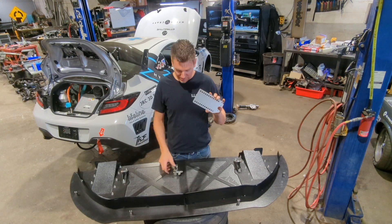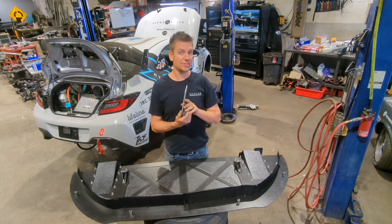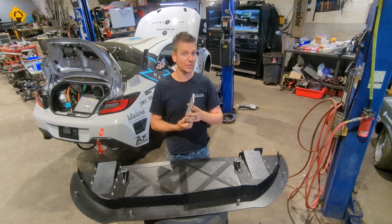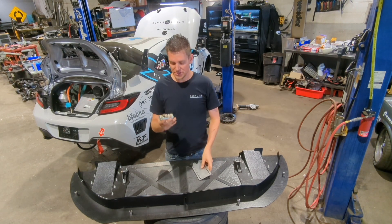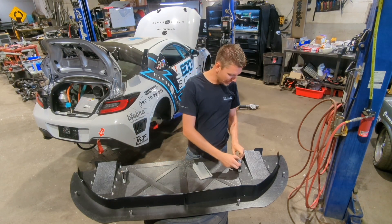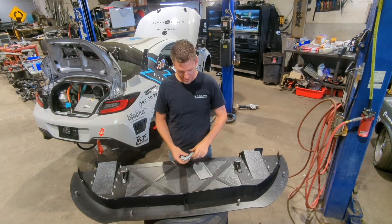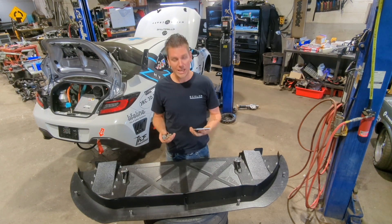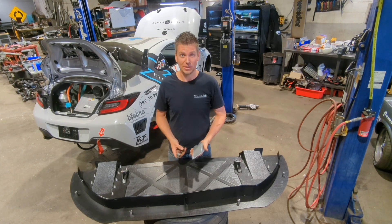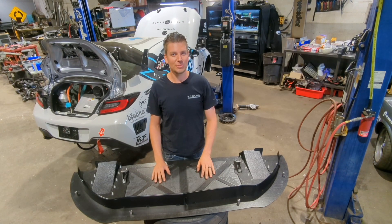On the bumper you'll see that we have these plates. These plates bolt to these latches, which are bolted up to the car and welded to the rebar. These allow different height adjustability so we can change the height of the splitter pretty easily. These latches are what we use for mounting the splitter — quick, simple latch design. When you put the splitter on, the splitter is attached to the car. Again, quick release, super easy to change. Professional Awesome has really nailed it with the hardware on this splitter and helped us out huge to make a really nice clean design to install on the SCR-1. Thanks for watching — don't forget to like and subscribe and follow us on this prototyping journey with the SCR-1.